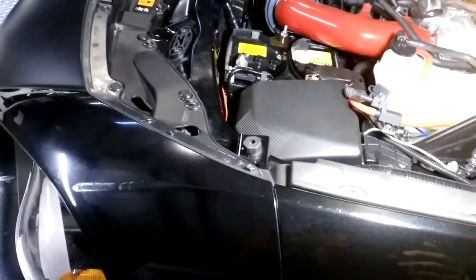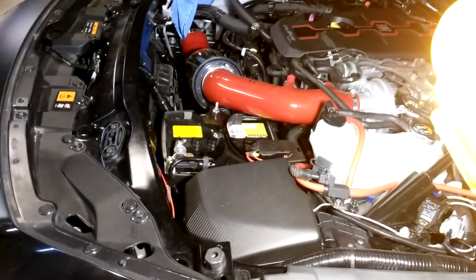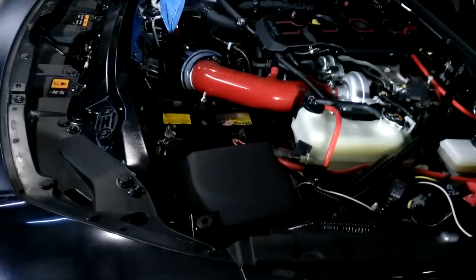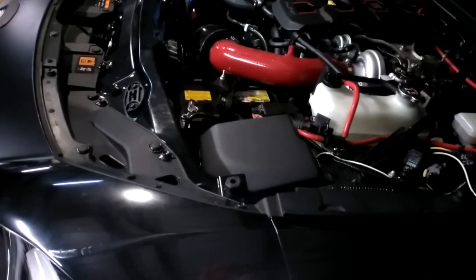All of this comes up the left side of the car, but at some point that fluid line needs to cross over to the right. I do that in front of the oil pan. The line crosses over to the right and goes to a check valve. Then from the check valve to a nozzle, which is fit into the cold side intercooler piping with a fitting from Devil's Own that is made for that purpose.